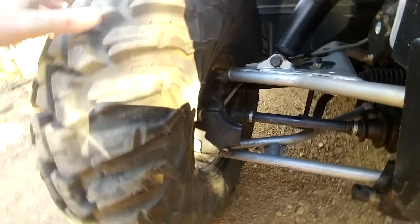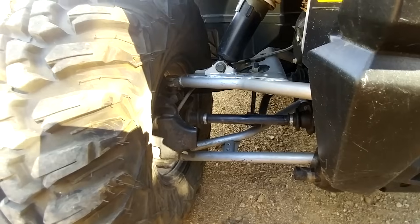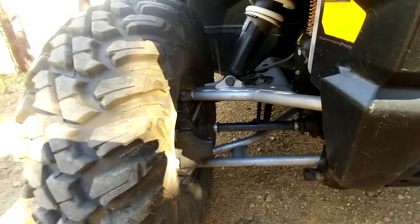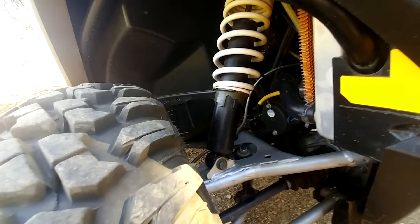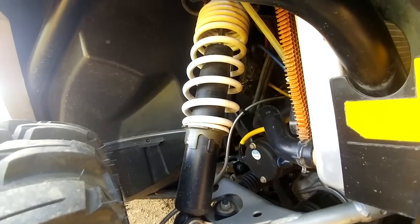I still have the original brake pads and brake rotors at 6,000 miles. I check them now and then, but they're fine. Changing them isn't a huge project, but there's been no need. The shocks and springs — the front ones are in pretty good shape. I've added one click of preload to help with suspension sagging and ground clearance. I experimented with more preload but it makes the ride too stiff, too uncompliant for an off-road vehicle.